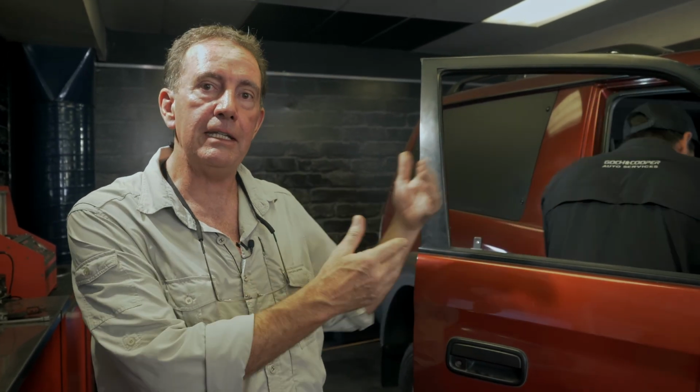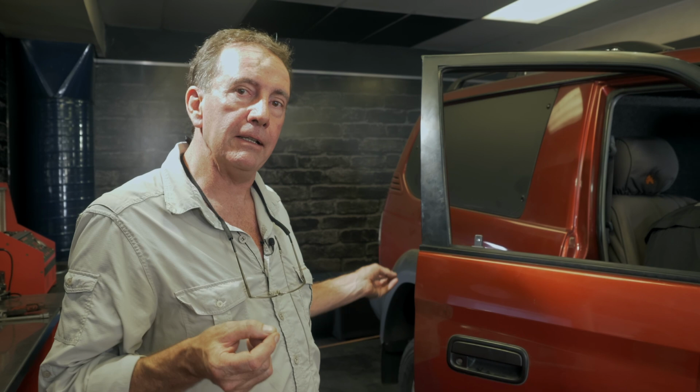Part of testing in this sort of closed environment gives you an opportunity to pick up little problems. One of the things that Mark has picked up is the smell of the brakes. Now the back has got new handbrake shoes, which sit inside a drum, and new brake calipers that are overhauled, and a brake master cylinder. Because it's only heating up on one side, very likely it's just a handbrake shoe that's binding. But these are the sort of things you pick up. These are the little things that you've got to adjust and tweak, and make sure that before you test it on the open road, you have gone through the car a few times.